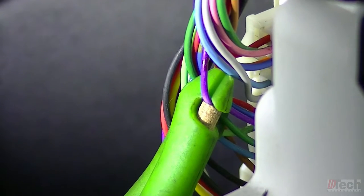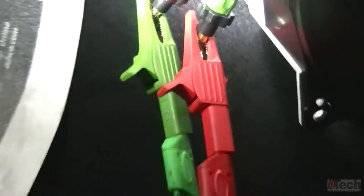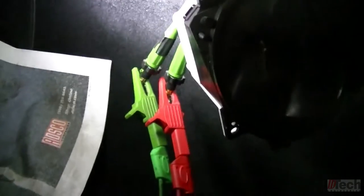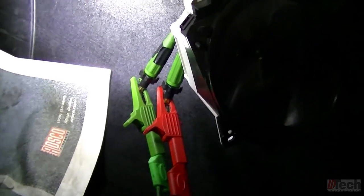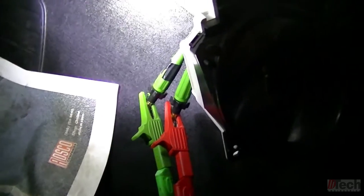I don't know if you can tell or not. The purple one is the input from the traction control unit. And the other one is the green wire. It's hard to show you on here, but the red lead is on the input, so the purple wire. Green one's the one going to the engine computer, which would be the same as the blue lead that I got at the computer, which will help us check the, I guess, integrity of that wire from here to the ECM.